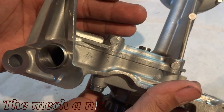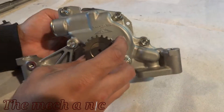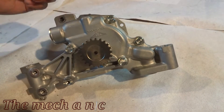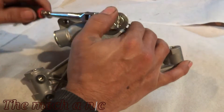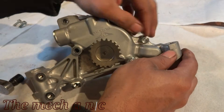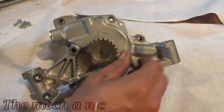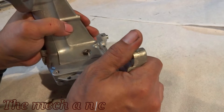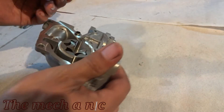You can see it's engraved here with the 4P logo. Granted it's not the best engraving - it's not as fancy as the ones they put on their cylinder heads - but it's still something to give you an indication if it really is a 4P oil pump. Once you open it up you should be able to tell if it was ported or not.